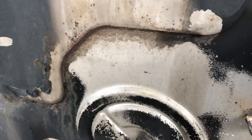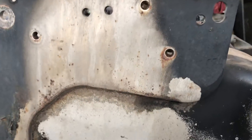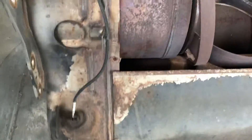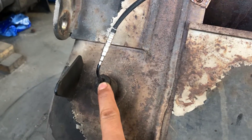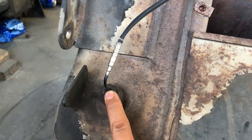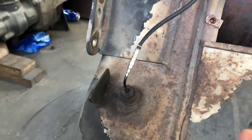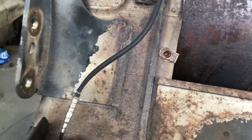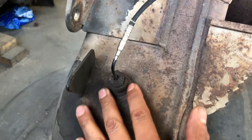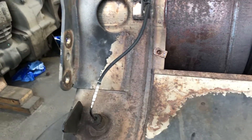That's a good change from Freightliner — it was a pain to change the valve under the chassis and sometimes had to replace the injector too, which was more costly. Now on the rear part of the DPF — drivers usually can't see this, only mechanics or technicians can. This is the SCR inlet temperature sensor. In the newer models, 2018 and up with the newer chassis, Freightliner removed this sensor entirely — they don't use it anymore.